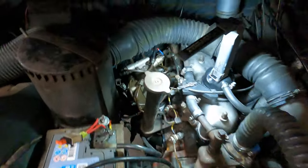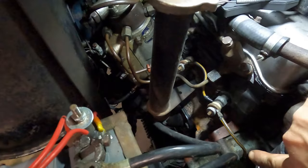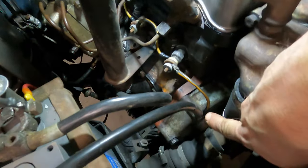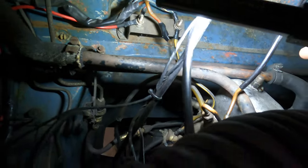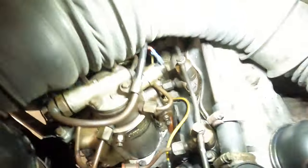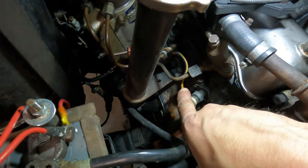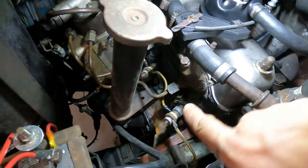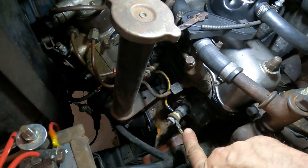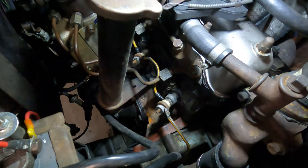Okay, if we take a look in the engine bay, you can see down here I've got our four glow plugs, and at the back there, there's another two. And they're all linked together by this cable. And as you can see, like I explained in the diagram, this one is earthed here. And the feed comes off of this coil, which is a resistor. So that yellow wire there with the black stripe goes to the first glow plug and then continues its way through. So what the difference is for this one example, the live feed comes in and it goes all the way to the end of the glow plug, which is a coil. And if that coil breaks, the live feed is broken, so it can't feed to the next one, which means all four stop working.